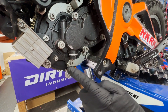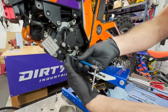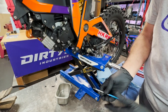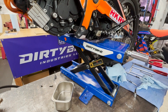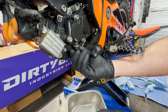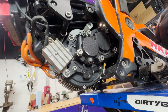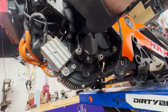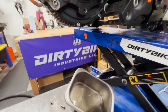It is 17mm, but this is sort of in the way, so this has to come off anyway — we're going to take it off right now. Now we can get to it. We also have to open the fill plug to allow air in there to let it all drain out, and it's already almost all out of there. You can see how much came out — it's not much at all.